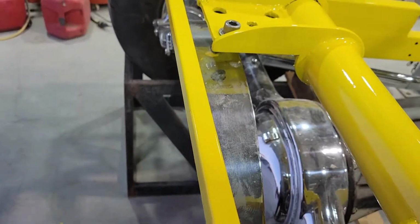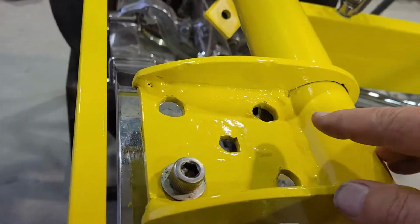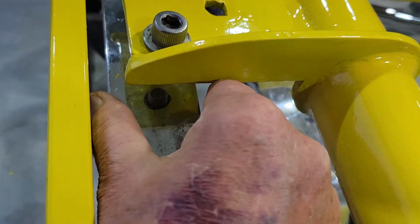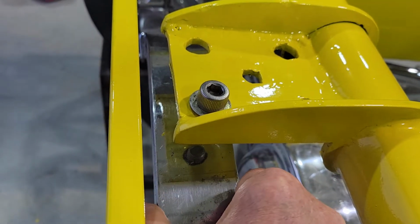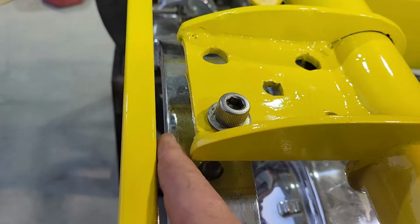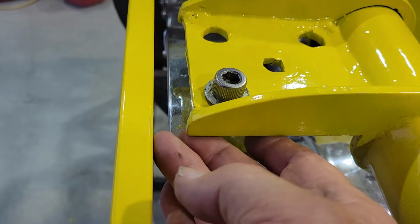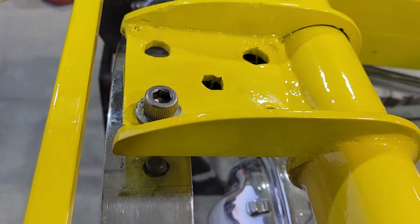So I'm going to build a plate, or have a plate built by a friend of mine in California, that's going to bolt in these four underneath here, and then pick up four holes that are going to get either studs or bolts that come up through the lower plate to put the spring on to move it back. I can only go so far because this piece of frame right here would hit, as this is about a level that's going to butt right into it. Anyway, so that drawing's been made and off to California to get built, and he's going to send it back to me.